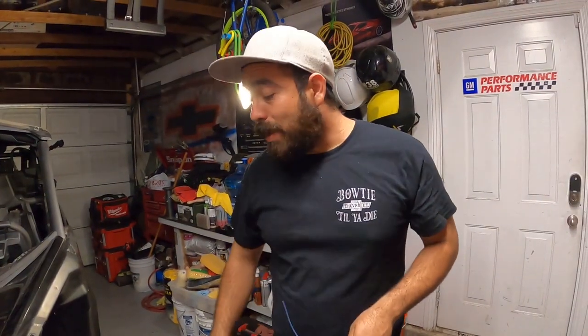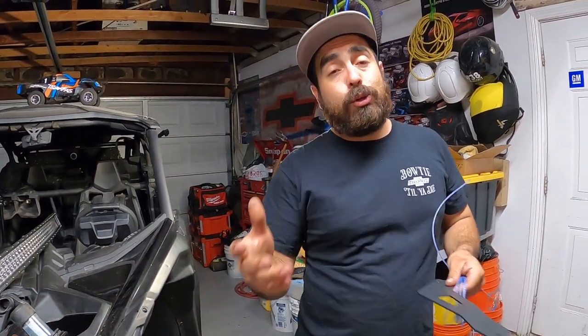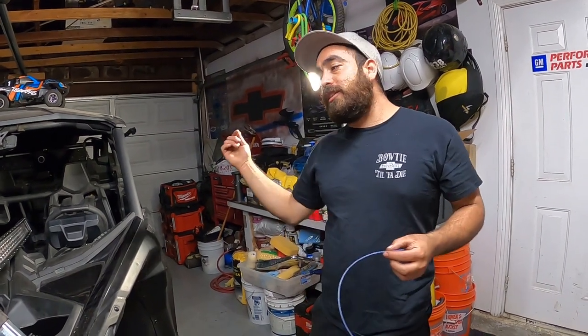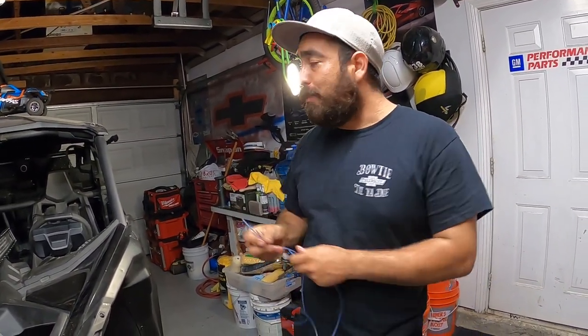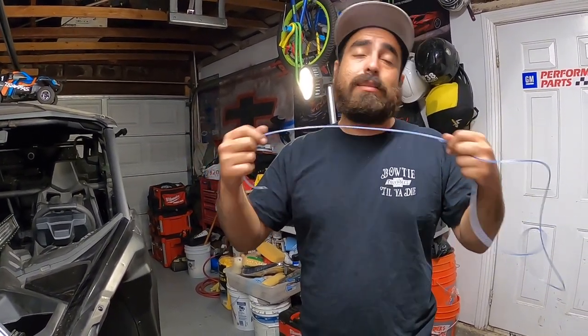I'm not going to get into mounting the light bar — that's just nuts and bolts, pretty simple. I want to focus mainly on the wiring through the tube, because it can be a little difficult if you've never done it before. Just shoving the wire through the tube and hoping it comes out the other side usually doesn't work out. The best thing I found is to use weed whacker string, or string trimmer string. It's rigid enough to push up or down the tube without getting stuck, catching, or bundling up.